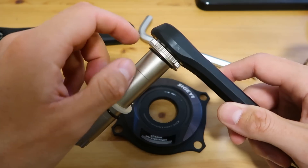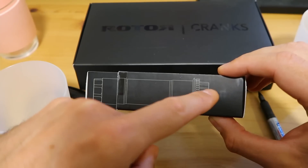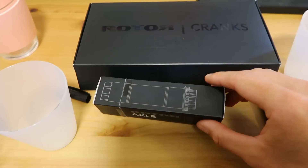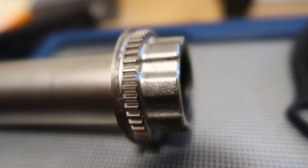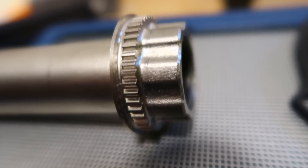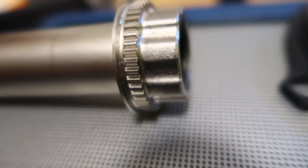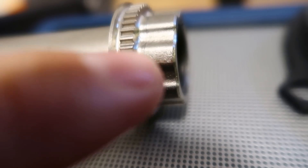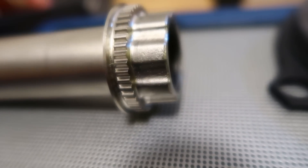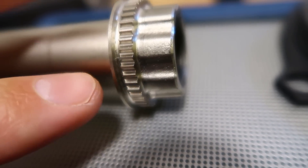The way they've achieved both at a set position — just enough locking on the chain ring spider and a really good mate all around the taper — is pretty damn impressive. This is a very fine taper, maybe one and a half or one degree, something like that. The finer the taper, the higher the possibility of axial drift or axial discrepancy based upon the machining tolerances. I'll take you through this with a bit of trig.